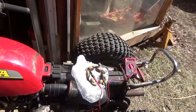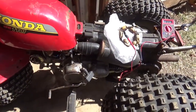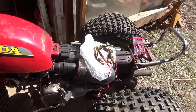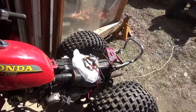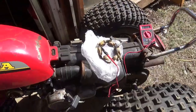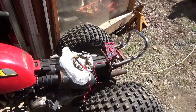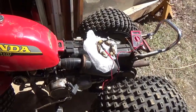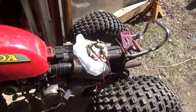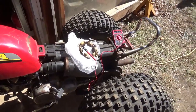This stator is from eBay — it cost me a hundred bucks and another ten dollars tax, so $110. Now it's just a matter of getting it in there. Hopefully we don't have any surprises. On these old machines, Honda is pretty good, but some other brands it's really a bear to get ignition parts. If you can't hack the ignition — like it has points and you can't get the parts — you've got a problem.